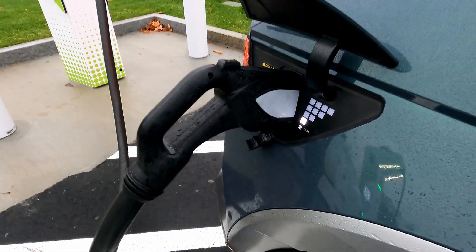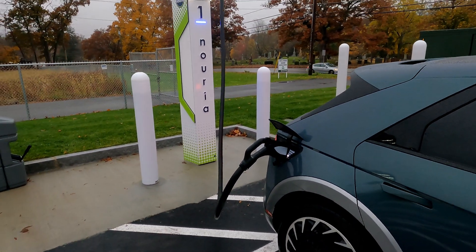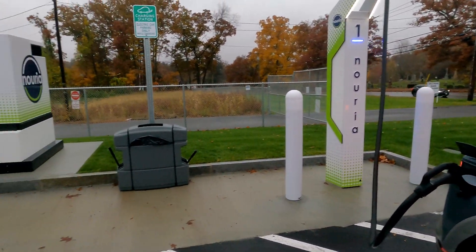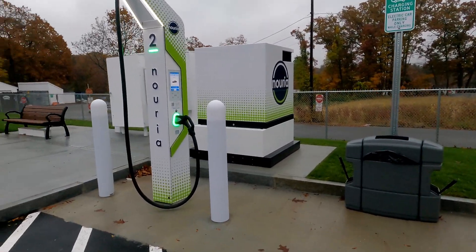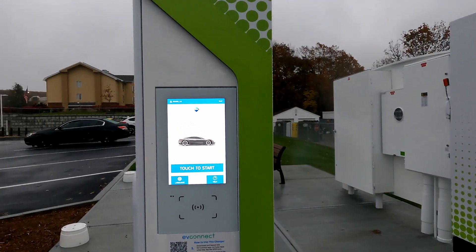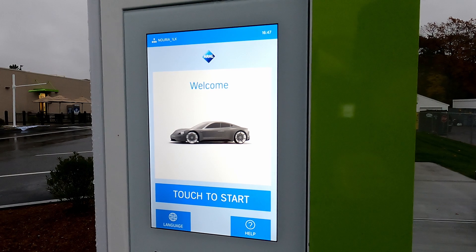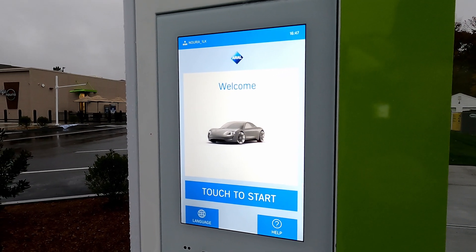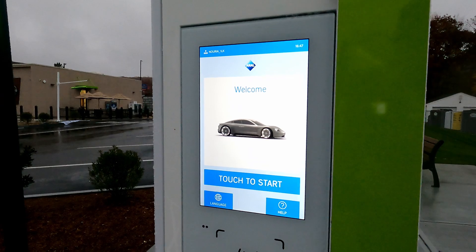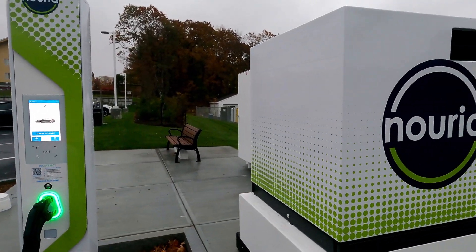ADS Tech is a German company that you may be more familiar with from Porsche dealerships. High power fast charging all the way up to 320 kilowatts in this particular system. One of the more unique aspects is that it is battery buffered against the grid, so you have a little more supply there — in scenarios where the grid is power limited, or you just want that buffer to trickle charge and maybe avoid demand charges by pulling power from the battery pack instead of the grid directly.